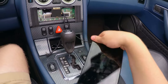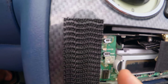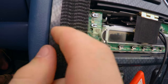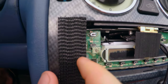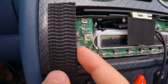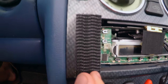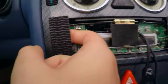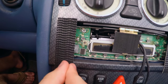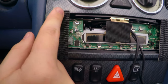You've got to get heavy duty Velcro. If you come in close, this is not actually just normal Velcro — it's not the fuzzy kind. It feels like plastic, and that's what you want. It's much higher rated and it will keep your tablet from falling down. It also needs pretty high adhesive because it's attached up here, on the side, and on the bottom, but it's floating in the middle. You've got to have pretty good adhesive.